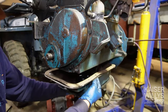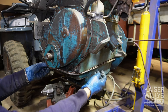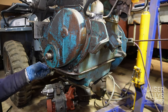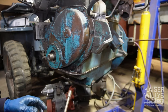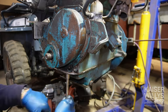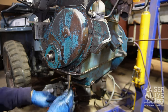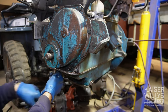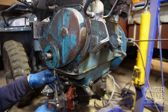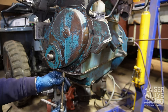Carefully lift the oil pan into place. Try to get one bolt started on each side about halfway down, then just go through starting each one. Always do this by hand and make sure your gasket is lined up. Finish tightening all the oil pan bolts by hand. I like to end with these four across the front — they are a little bit shorter than the rest. Bring them up until they're snug and not going any further, as these are very prone to stripping out.